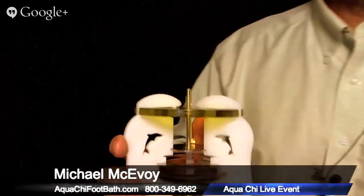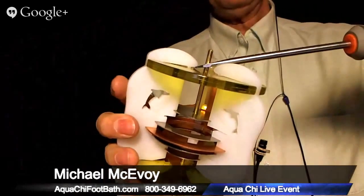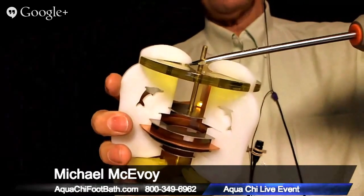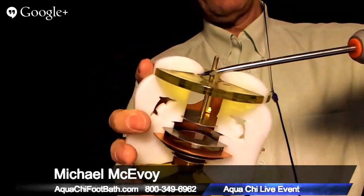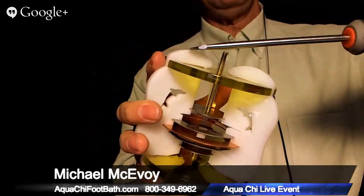How do you go about that? Well, the first thing to do is to put a flathead screwdriver into the indentation on the top of the module. Okay, and then you're going to give it a slight turn. Now, I say slight because you need to be careful. You're removing this white leg. You don't want to stress the plastic so much that you're going to break it.